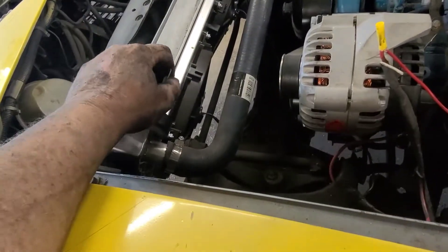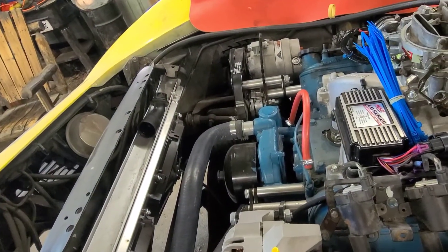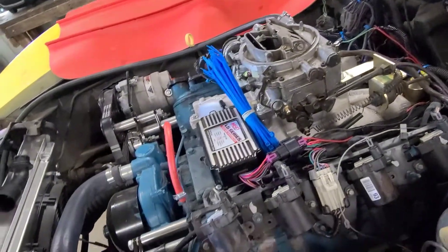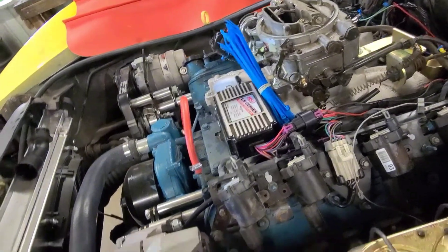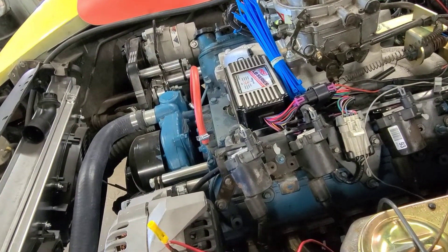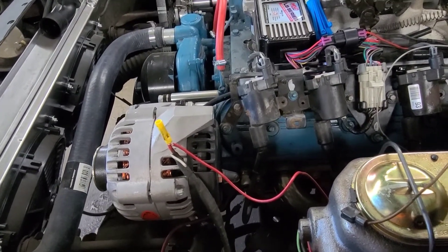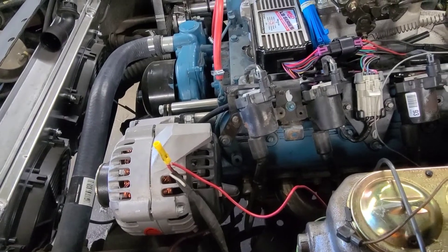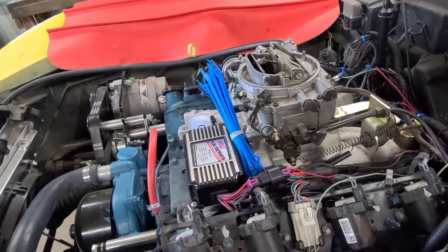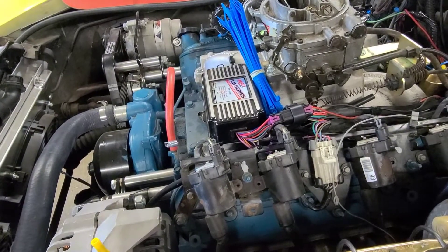I could bolt them up there — there's a handy place — but I don't want them in everybody's face. May end up going that route anyway. Getting closer — finish getting fans wired up, check the sensor, check all hoses, fill with coolant, put fuel in, let the fuel pump run and pump fuel through the line before hooking the line to the carburetor. Put a filter on it, fire it up, adjust the power steering control valve, hook the slave cylinder back up, and she's ready to go for a drive. Next video it'll be on the ground and pulling out of the shop.